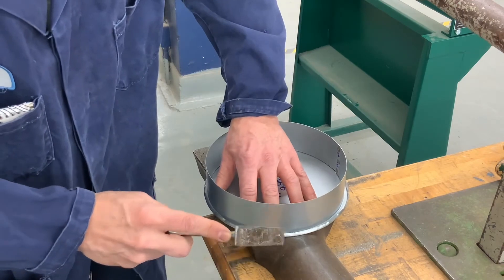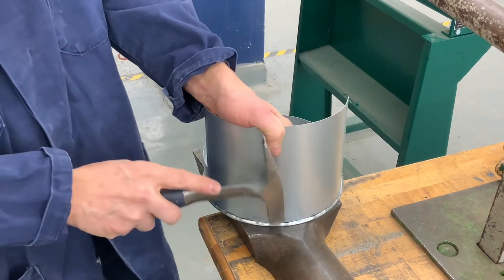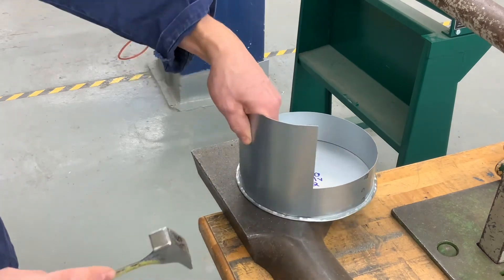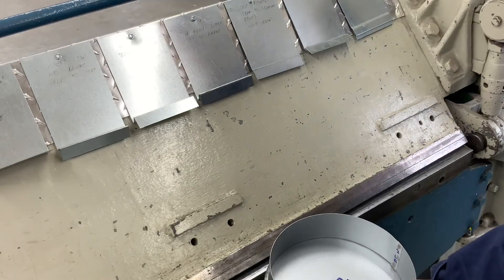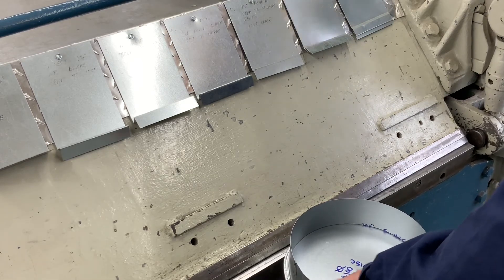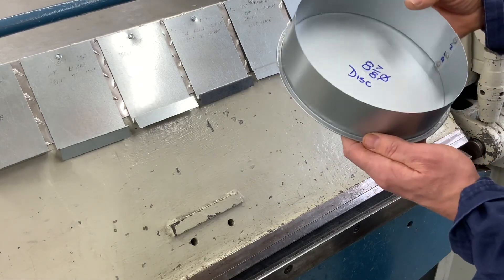Try and be as careful as you can not to dent or scratch the side of the body. Here you see me using a shield — the main reason is to stop the scratches and dents that may occur while you are setting your seam. Now that the seam is hammered down approximately 70 to 80 degrees, let's use the brake to finish it and close it off nice and tight. Be careful not to bring the brake down too tight because you could create kinks on your cap.